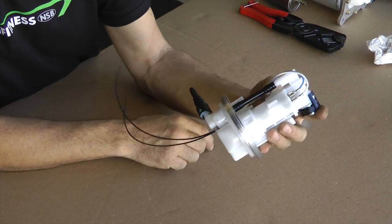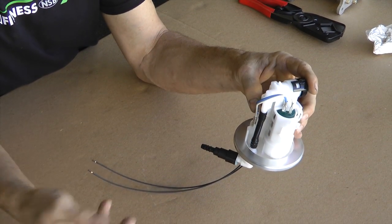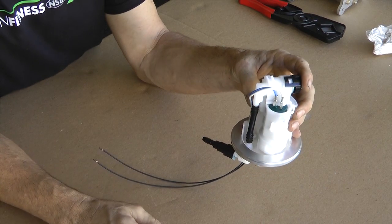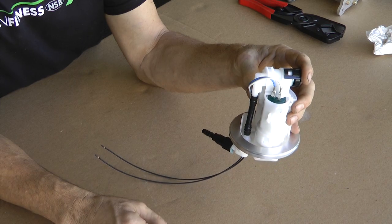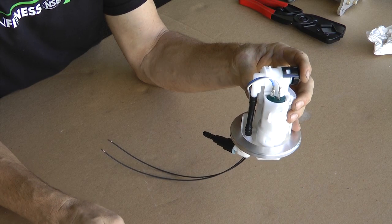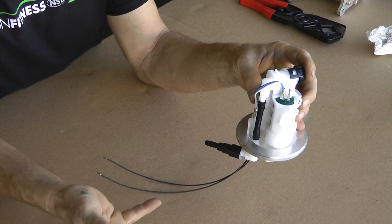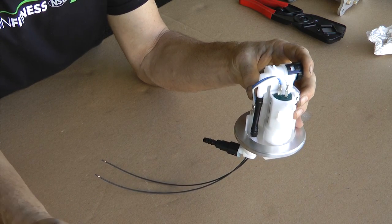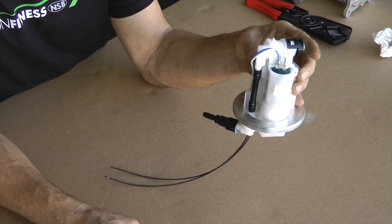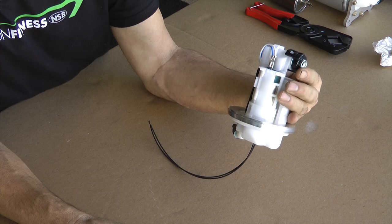That's the heart of the system. A very lightweight — about one to one-and-a-half pound — pump. You can put one in your fuel tank, two in each fuel tank for redundancy, or one in each tank to have redundancy between them. The only minor drawback if running one pump per tank is that if one pump fails, you also lose access to the fuel in that tank.